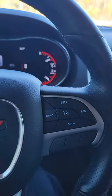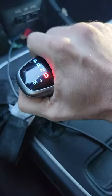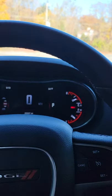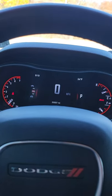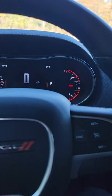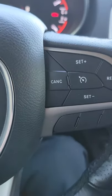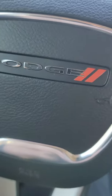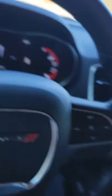To eliminate that, firmly apply the brake. Apply the parking brake while you're in drive, then go to park. The vehicle should not move much — that's just enough so the wheels can engage in the drum and hat assembly on the brakes and hold the vehicle in place, relieving the tension off the park pawl. Take off the parking brake, foot still applied, go to drive. No bump or clunk.